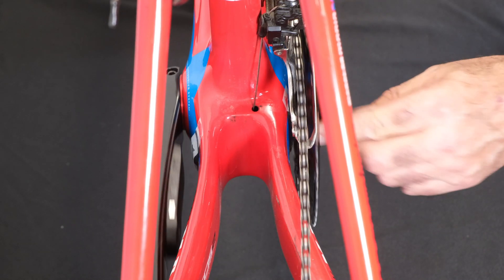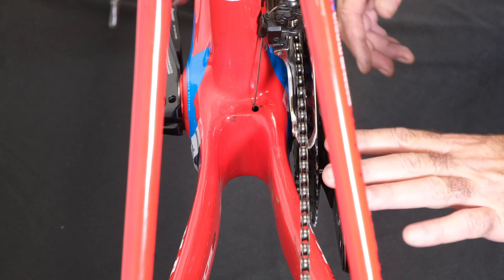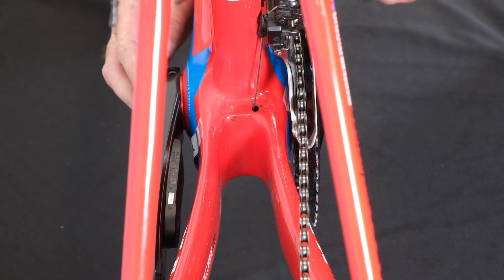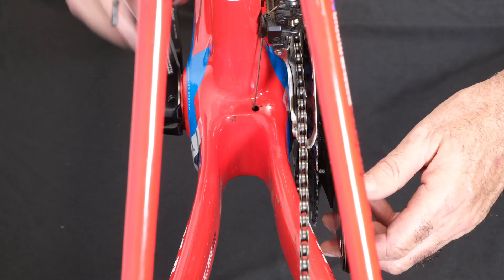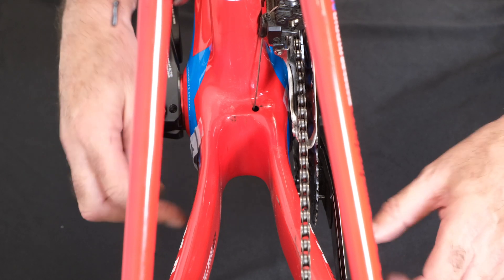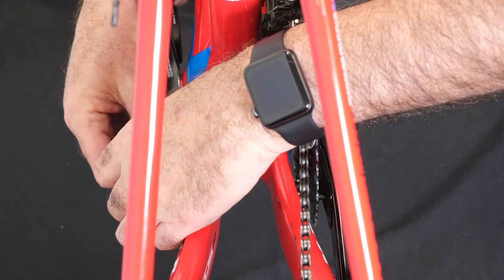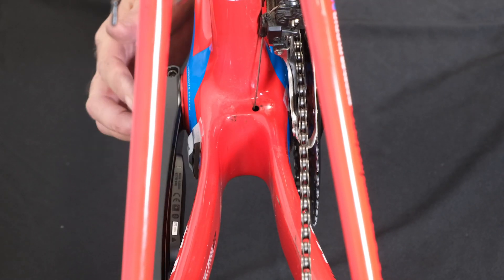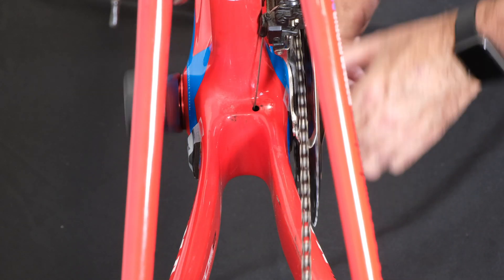On the right side, that's usually no issue — in this case I've got three millimeters clearance, lined up perfectly, so there's going to be no issue with distance on the drive side. On the left side I'm right at it; it looks like around 10 millimeters, and that's where the spacer shims come in. I'm just going to try it to see if I can get a little closer. I've got about a three millimeter clearance between the sensor and the magnet, and I think that's the setup I'm going to want to use.